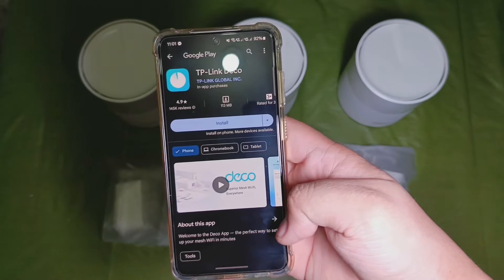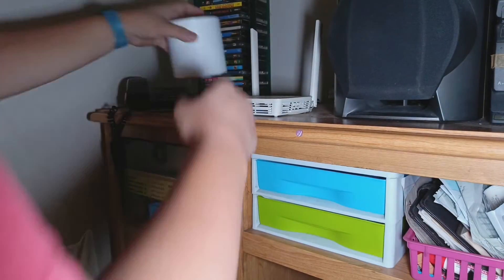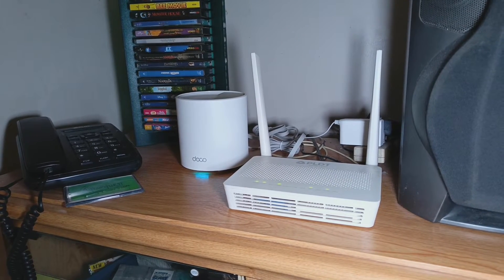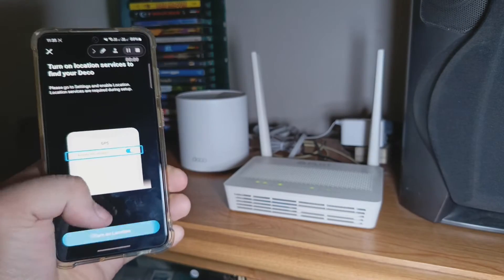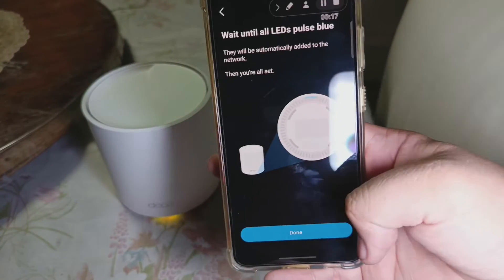Now that I've explained some of the terms used in the product, let's go ahead and set up the Deco X20 mesh. But before that, you should install the TP-Link Deco app on the App Store or Google Play and register or log in ahead of time for a smooth setup. First and foremost, you should turn off the modem or router so the process will be seamless. Once done, you can put the Deco X20 with the included LAN cable into the Ethernet port. On the Deco app, click Let's Begin and choose X20 as the model, then turn on the router and mesh. Follow the on-screen prompts — choosing the connection type, putting in the Wi-Fi name and password, and connecting the other nodes to the main node. I didn't have a hard time manually scanning the nodes like I did with my old mesh router. I was basically done with the setup on the Deco X20 in less than 5 minutes.